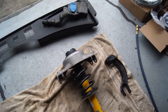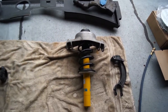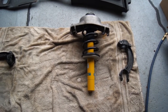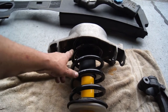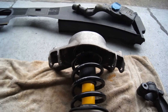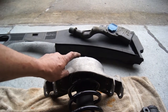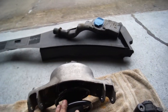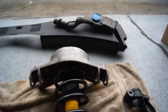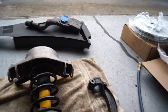We got them together. I didn't have to use a compressor or anything — they just spun on. They pushed down a little bit. But the new nuts are 19s instead of 18s. I guess Bilstein wanted a bigger nut. I really wanted to put the Eibach label out so you could read it, but the pad in the hat up here is keyed, so you can only put the spring in two ways — this way or upside down.